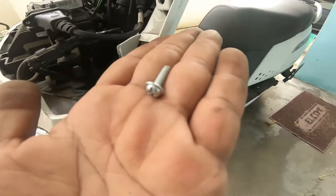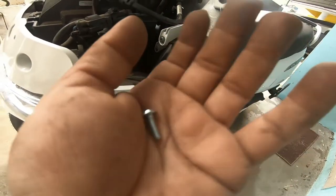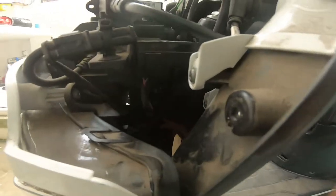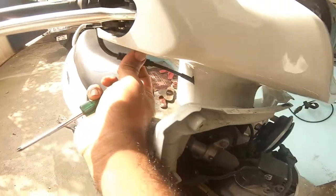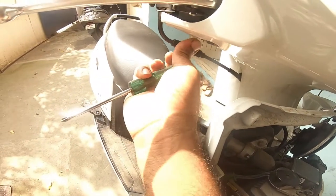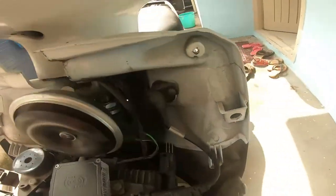I am replacing with a new screw — I suspect the screw was not tightening enough. Make sure you keep it gently tight here, so the close throttle error will go off.